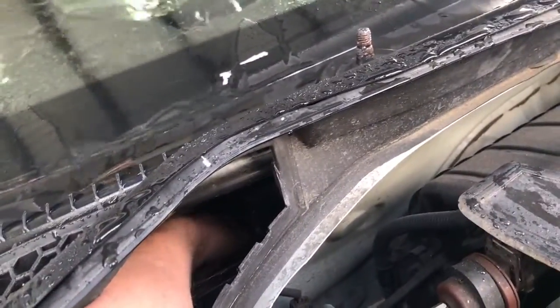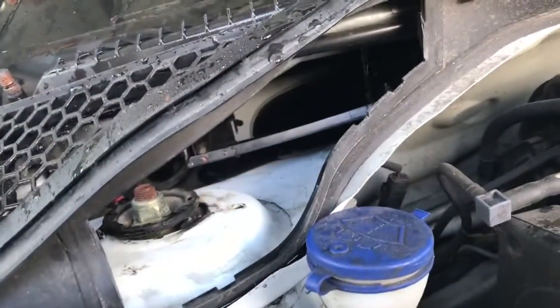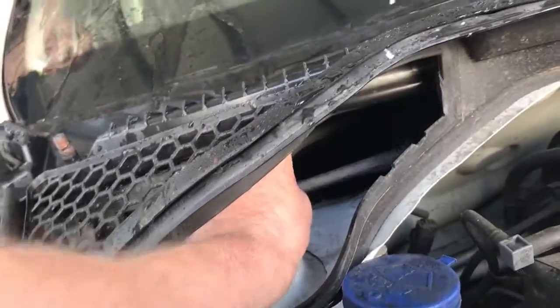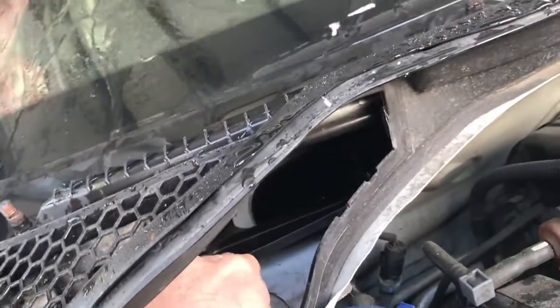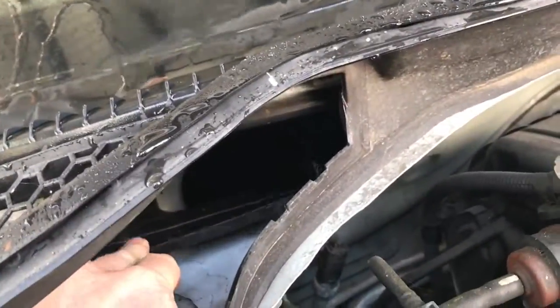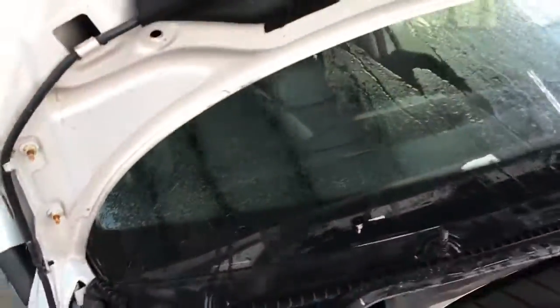Connor's just running a gentle run down, so you can see — if you put your hand in there and feel it — right into the housing, it's wet there. That's where it's running in, so we need to fix this problem. You can see it dropping straight into the pollen filter there. That's the housing for the pollen filter, which leads into the car.